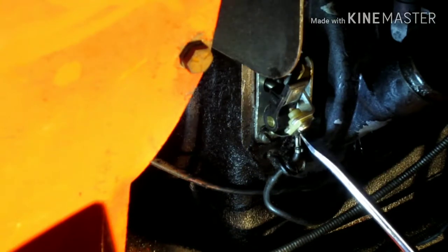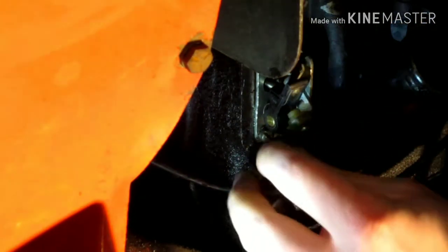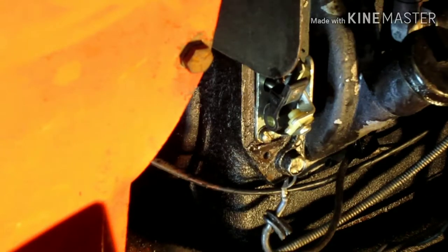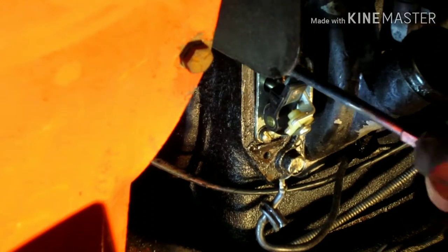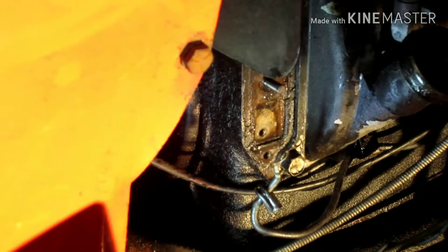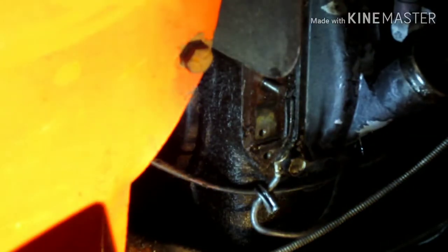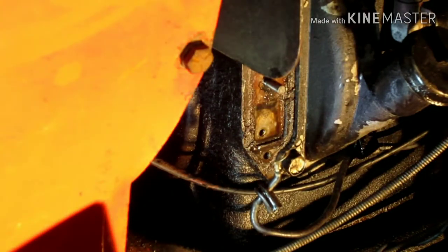And loosen this screw here, just the tiniest little bit, and the wire slides off. You can see that there is notched. I don't know how well you guys are in focus here, but like I said, it's a new camera. And then take the old points themselves off. Two more screws, and they should come right off. Don't lose those screws, because you need to reuse them. And you have your old points. And then for the condenser, I'll have to reset you guys up. I'll show you how that comes off.